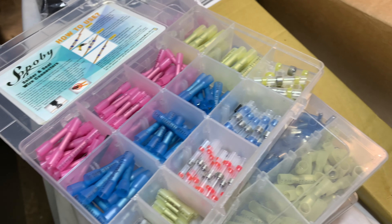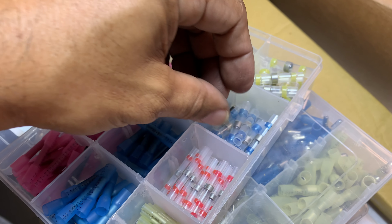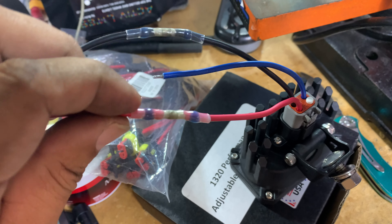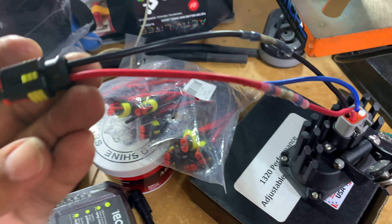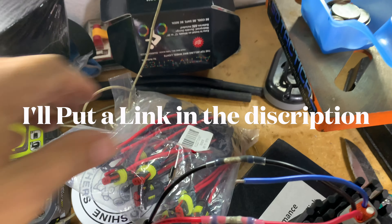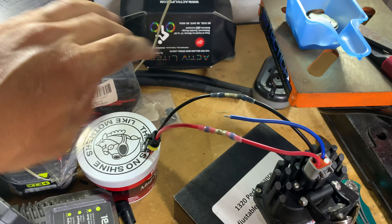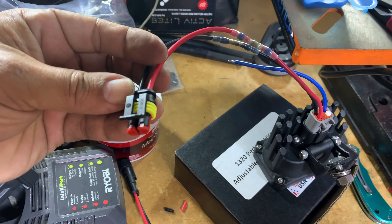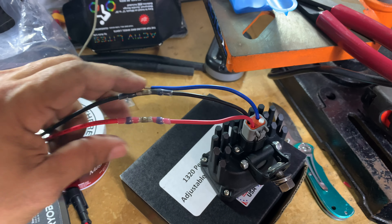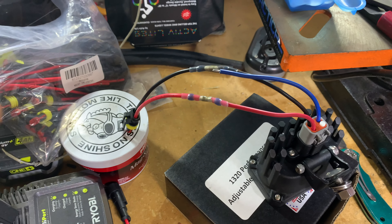Before I put everything together, I got this whole connector kit from Amazon — I'll put a link in the description. These are the ones that you heat up and they kind of melt — they have like a flux core thing. So I'm gonna put these weather connectors on; it comes in this bag with male and female sides. That way I can plug it in and unplug it whenever I need. And I have a wire loom cover that'll hide everything and make it really nice and clean.